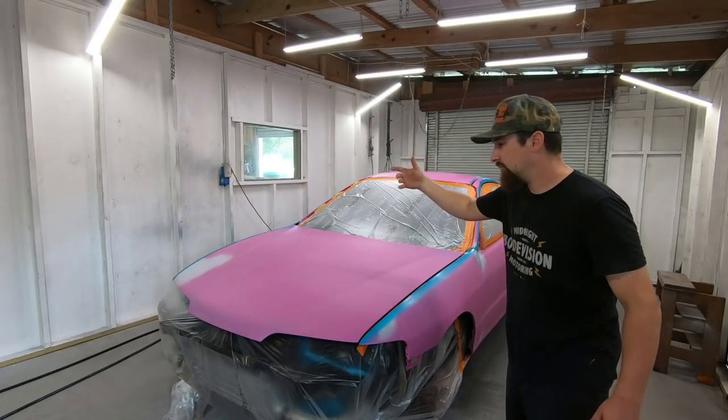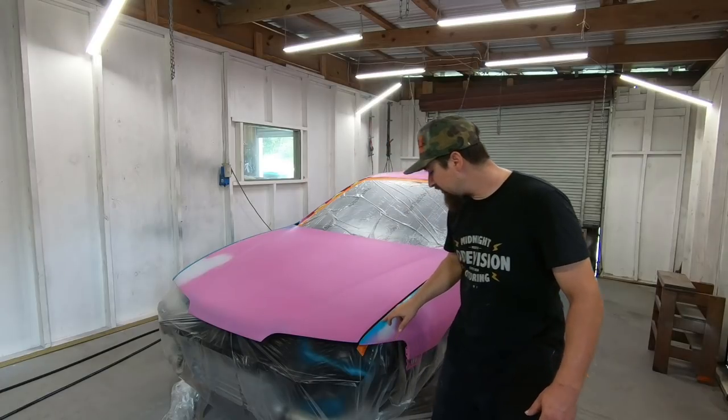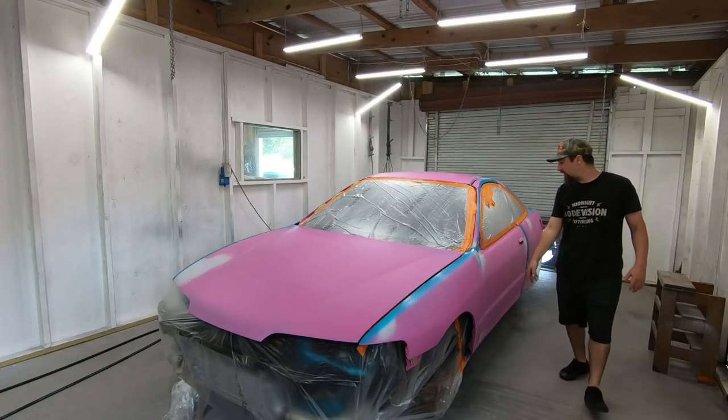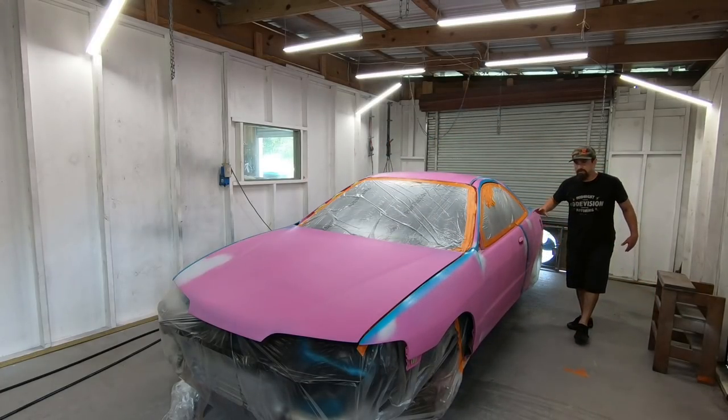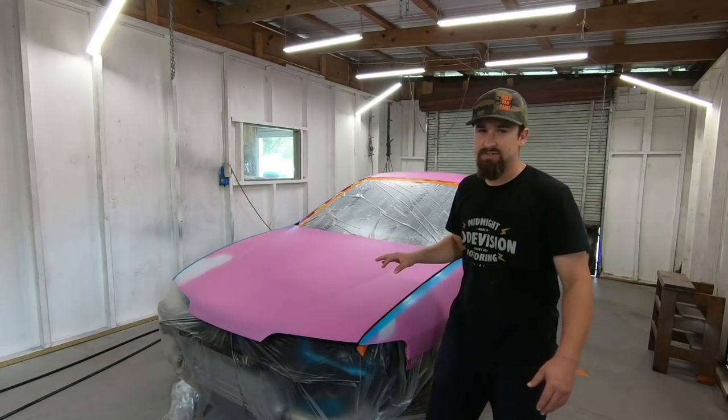That's the steps that I did with everything else. The engine bay, all the jams and everything. And that's why there's this kind of spill out onto the body. This is all from the jams. Everything's been done with 600. It's a nice, smooth, uniform, consistent surface. Once that white goes on, it's going to be a nice and consistent color. And then we'll go into that base coat.